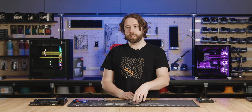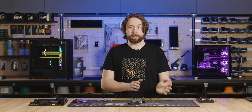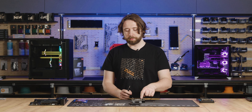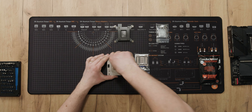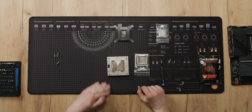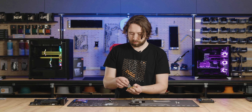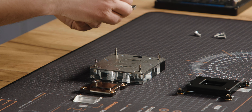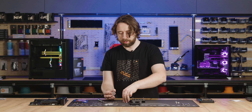The first thing we're going to do is upgrade this regular nickel plexi LGA 1700 block to direct die. If you already have the direct die block, then you can skip over this. With the back plate removed, we're going to remove the four screws of the cold plate and attach the new cold plate and jet plate. Just pay attention to the position of the cold plate and where the indexing triangle is, and make sure that your new cold plate is going to go back in the same place. With the screws removed, the old cold plate and o-ring along with the jet plate will lift off, and you can keep those should you ever want to return to non-direct die cooling.